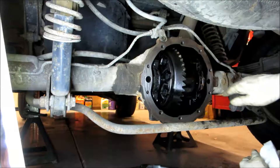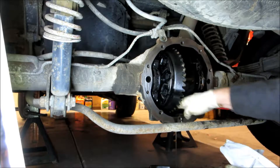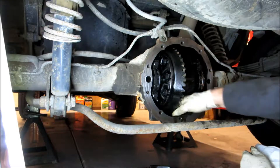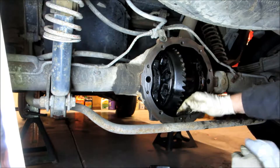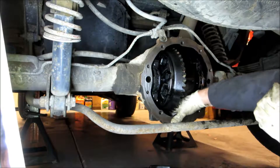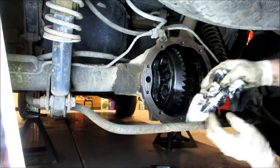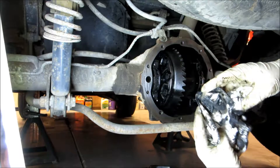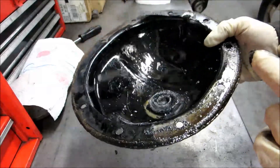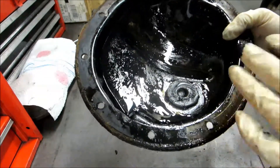On the bottom of the third member, use your fingers to push out as much of the old gear oil as you can. You also want to look for any metal in the oil. All this looks really good, so I'm going to take one clean rag and slide all this old oil out from inside. This differential has 290,000 miles on it and it looks like this is the first time it's ever been serviced, so this isn't bad. We're going to clean it up.